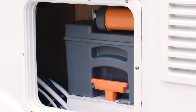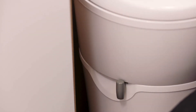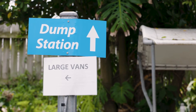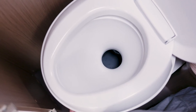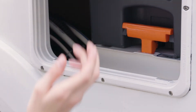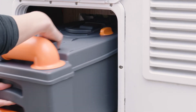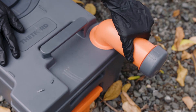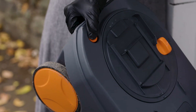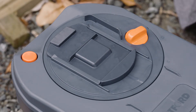The toilet empties into the toilet cassette under the toilet bowl. Use the lever on the side of the toilet to empty the contents into the cassette. You can empty the toilet cassette at any approved dump station. Before emptying the cassette, lift the lid on the toilet and check the flap sealing the outlet is closed. Open the toilet locker door to remove the toilet cassette. Lift the release lever and pull the cassette out. Swivel the spout outward and remove the end cap. Pour the contents into the drain while pressing the breather button. Turn the knob then slide back the lid.